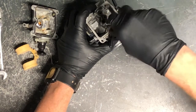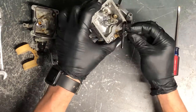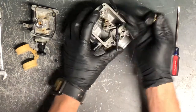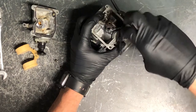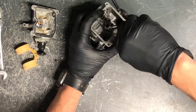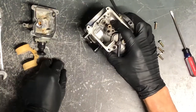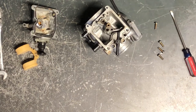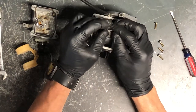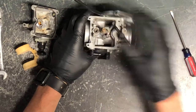The number of turns depends on altitude, air temperature, and similar factors. Here's your air/fuel screw — there's a spring on it and a small pin on the bottom, so make sure that pin isn't broken off or corroded. The spring keeps it seated so it doesn't walk itself out. Go all the way in and then pull it out the proper number of turns — half turn, full turn, half turn, full turn, half turn — that's two-and-a-half turns. The bigger-hole jet is the main jet; if you mix up the secondary and main jet, the bigger one is the main, which is where the needle slides down. The secondary goes beside it, and the pilot jet goes down into the smaller port.